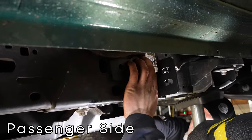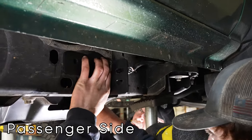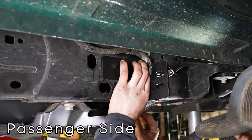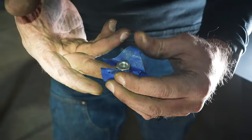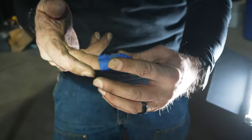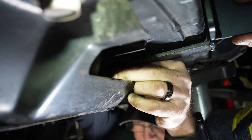Here we're on the passenger side, putting the frame mount up against the frame. It's coming up underneath the skid pan for the fuel tank with an inch-and-a-half 3/8 bolt. Tape the nut to your finger so you don't have to hold it with two fingers — you can get up in there in a tight spot easier. Just hold that on top of that bolt.